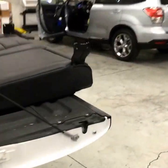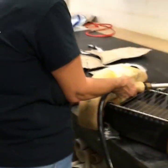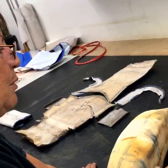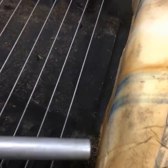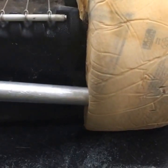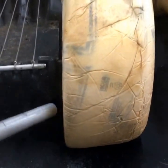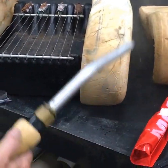Let's go over to Judy — one of the Facebook favorites, always got something cool going on. She's got the steamer running on this bass boat that we're working on. Right now she's steaming the foam to puff it back up and get some of the creases out. You can see it actually swells back up — it slowly grows and comes back to life. The steam rejuvenates the old foam, even though it's compressed from sitting on the boat so long and being wrapped in old vinyl. Steam opens up the cells in the foam and brings it back to life.